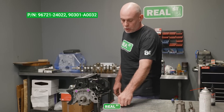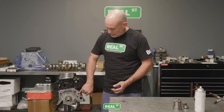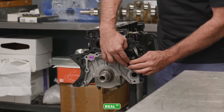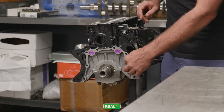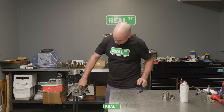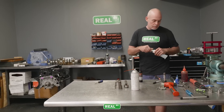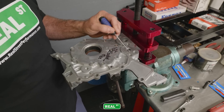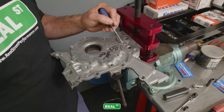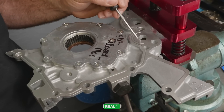Now we've got two new Toyota O-rings. Use new O-rings on the pump and make sure there's no silicone left in any of the O-ring retention slots. These O-rings go in dry and just pop in and sit there. If they don't want to pop in, you've probably got silicone residue left in the radius or machined area of that cavity — use a pick and scrape it clean. Silicone goes in this cavity here but not in these cavities — those two are overflow cavities to catch silicone that squeezes out so it doesn't go into the oil galleys of the engine.